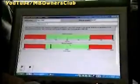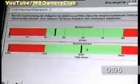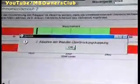Pressing OK moves on to the next torque range. This lies between 40 and 80 Nm. By the way, limit the automatic transmission to between 2nd and 4th gear. This enables you to prevent the automatic gear shift. And then the second torque range has been adapted.